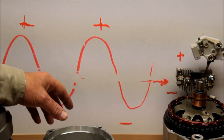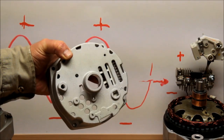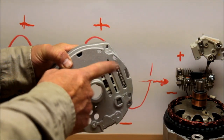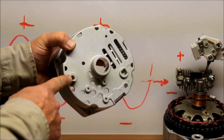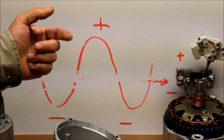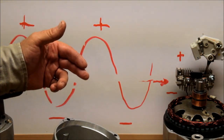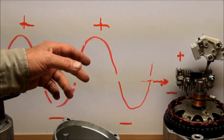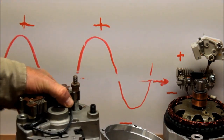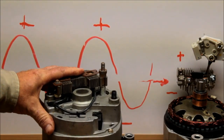What people should do is add one more to the big three upgrade and run a grounding wire right from the back of the alternator — where the negative portion of the bridge rectifier dumps the negative power into the housing — run a grounding wire from here right over to either the negative post on your battery or where the negative post connects to the motor.